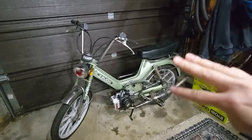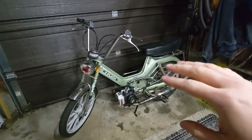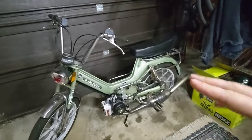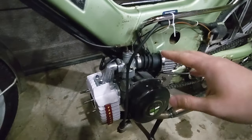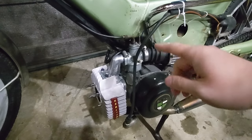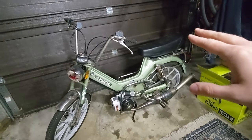In that video, we'll be fighting the three monsters you must face if you want a well-tuned moped. We'll start by tackling air leaks — and if you have a keen eye you can see the head is off, I've already started looking at one. We'll look at timing, which I just eyeballed just to get this bike running, but we can definitely do better. We'll also look at jetting the carb and making some other modifications, because while I believe this is a genuine Bing, it came out of a parts bin. I know it's got a 2.15 atomizer in it out of a Bingzilla — the 17mm Bing — which is probably a little lean for it. We'll be playing with that and some other parts to get this thing right. Hope you're enjoying the series — until next time.